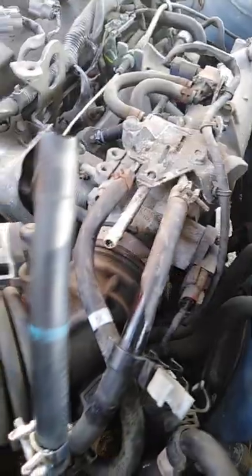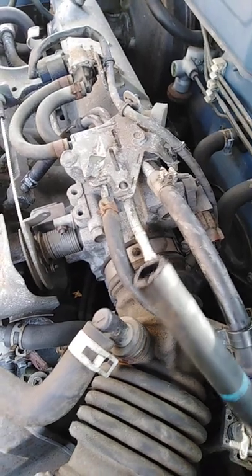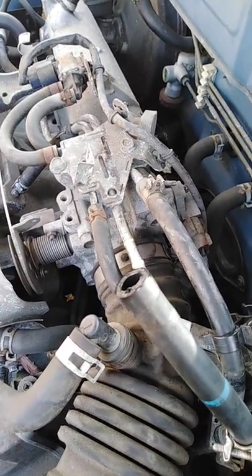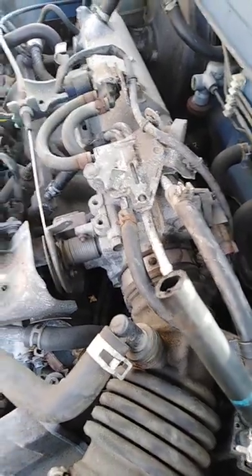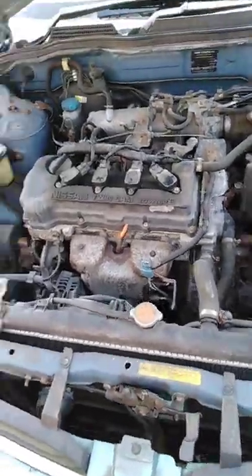Brian, go crank it please. When you turn the ignition on, fuel should come up. The ignition is on and there's no fuel. Crank it as well — we haven't got any fuel. So our problem is fuel.